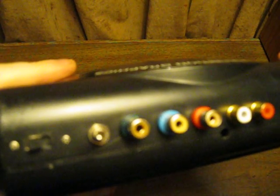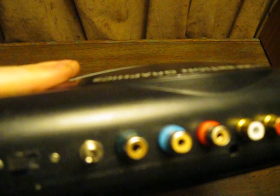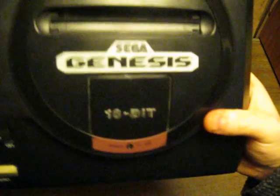So in cases where, like Sonic the Hedgehog, when you collect 50 rings or whatever, and then you suddenly get hit by an enemy, the game will slow down because the system will render all those 50 rings as sprites and the regular sprites on screen. So there'll be way more sprites than the system can handle, and the system will slow down. Now, if you flick it up to 10 megahertz, this doesn't happen. All the rings go flying, but the game remains at a steady frame rate. So, all that said, let's show you the system in action.